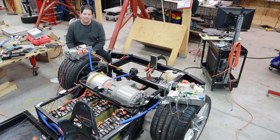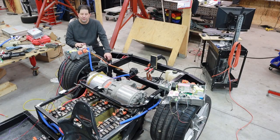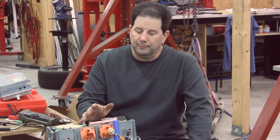All right, so here we are at the back of the car. What you see on the two tires are actually the chargers themselves. I'm doing a bit of a modification of the chargers, nothing major. These can actually run in what's known as a master and slave component. To do that, you do some wiring on the inside of them. If anybody's interested, I can go ahead and give a link. But again, these are Chevy Volt chargers. Each one is about 3.3 kilowatts of power, so I got a total of about 6.6 kilowatts